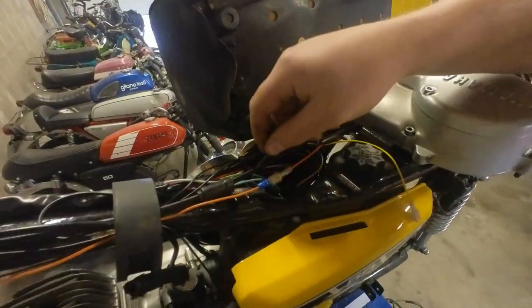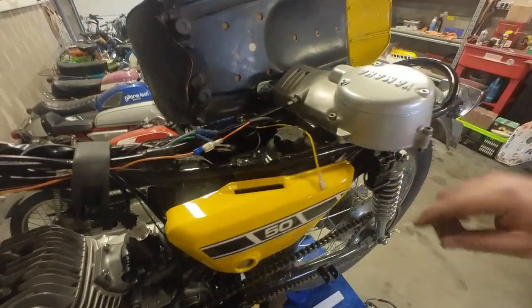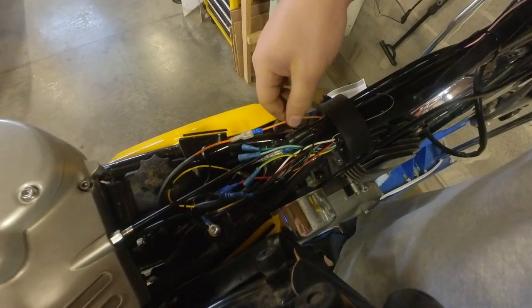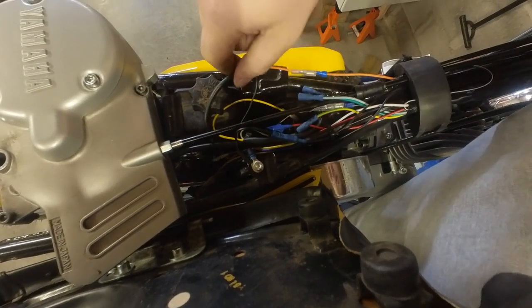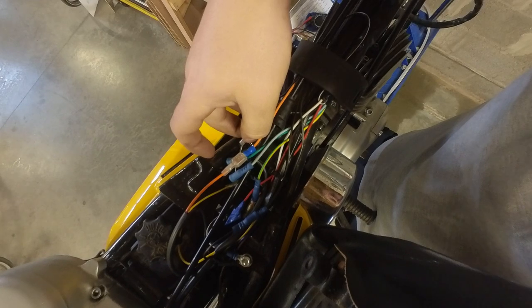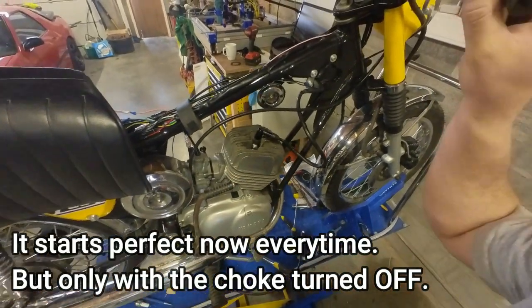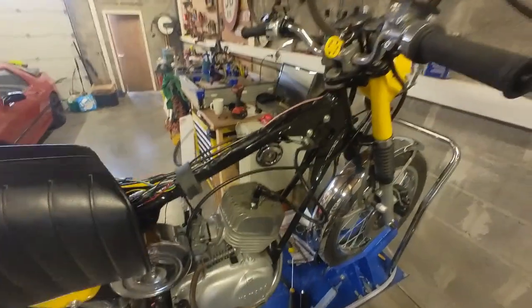I still have to figure out the wiring - I think one of these should be for the lights, but we have to change the bulbs first because they will blow out. As a summary: I've connected the signal wire to the coil, black is ground connected to the ground point, and the black and white wire is the emergency stop - if you connect this to ground it will switch the bike off. The key is on now - nice, it works mint.